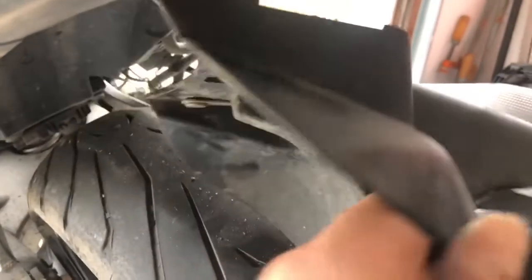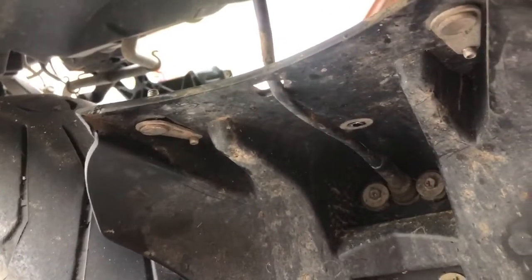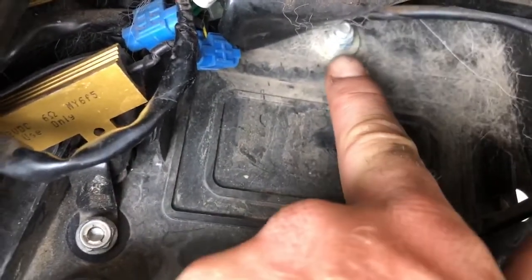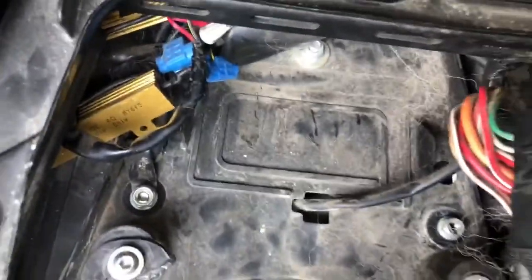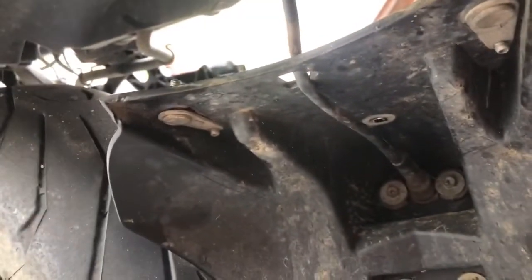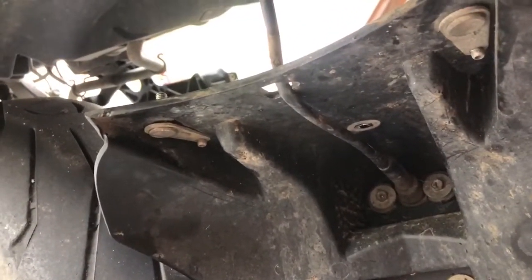The next step is to remove the plastic tail so that you can remove those bolts with the two fasteners — you've got to pry those off. Looking back inside the motorcycle tail, you can see the bolts you have to undo to get that tail off, then access the plastic fairing underneath and use a little bit of leverage to pop those off and take them off completely.